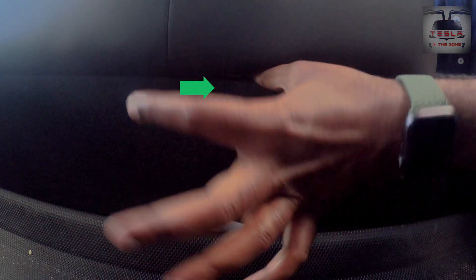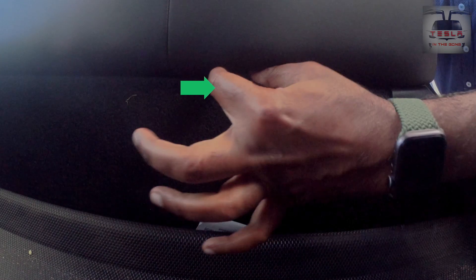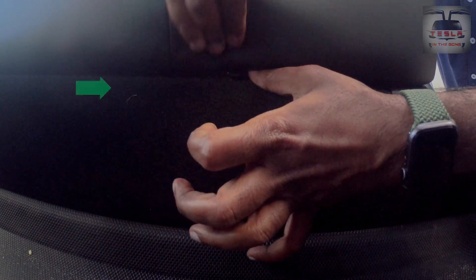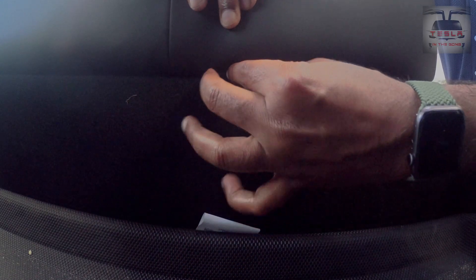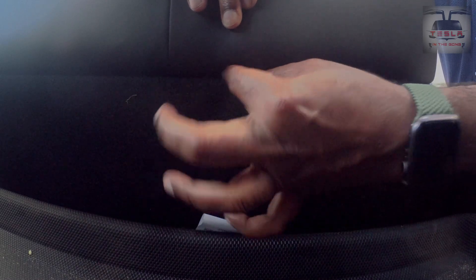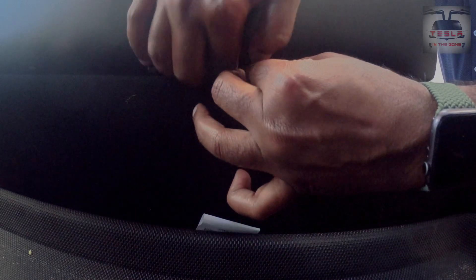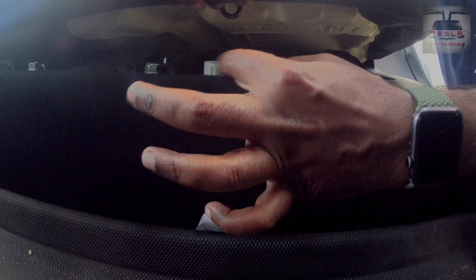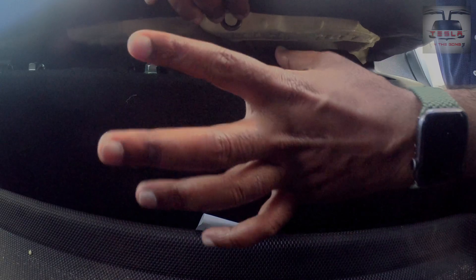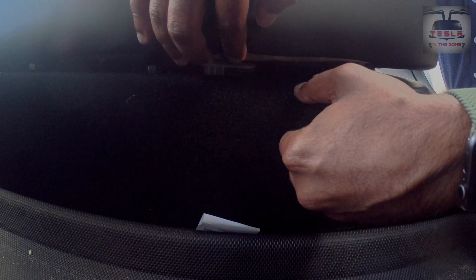Next up you can move to the rear seat. Here you need to identify, unlatch, and lift up the rear seat just like this — it's quite easy to identify that latch. All you need to do is run your finger at the junction between the seat and the carpet and you'll find the latch. Push the latch towards the midline and that will unlatch the seat and you can lift it up. I found it best to unlatch both sides, although the connector you want to access is on the right side of the car behind the driver's side.